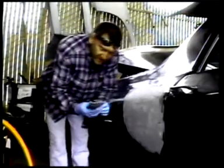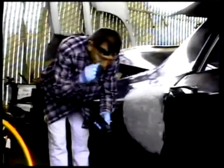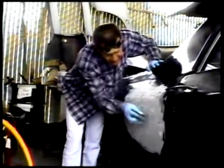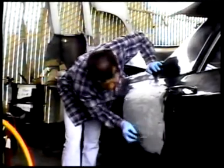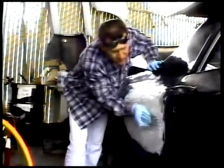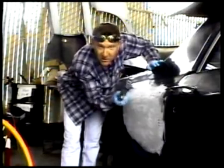This is our cheese grater because it resembles a cheese grater, so that's what we call it. Stanley makes this. It's a handy little tool. After the first coat of Bondo, you scrape to get some kind of a shape of the body. And it collects inside, and they call it a cheese grater because it looks like you're grating cheese.